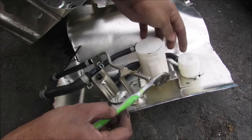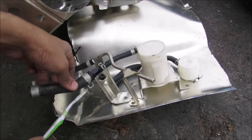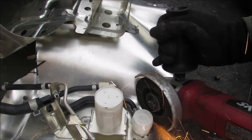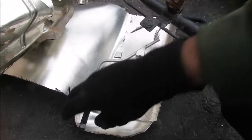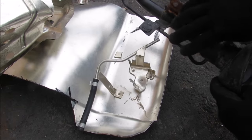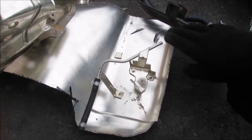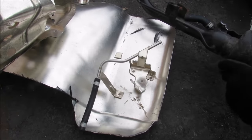The baffles still allow the fuel to level itself off in the tank through holes punched into this thin steel. Here we have the fuel check valve — we've got two hoses that come up into this one hose here and this goes over to the charcoal canister. This small little tube here connects to the filler neck and basically vents this when it's being refueled. In its current position it's actually at the same level as where the fill check valve would be.